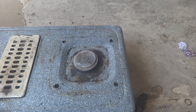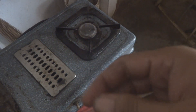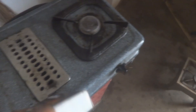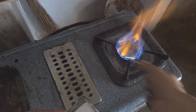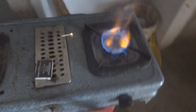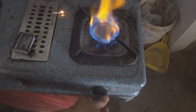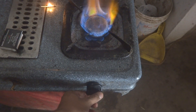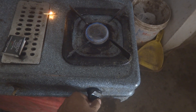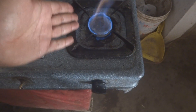Now I am going to test it — I will show you the testing. Open the gas valve. Now we will switch on this unit. As you can see, now it is burning, and it is burning very well. There is a control — you can see small flame, big flame, medium flame — any type of flame we can control. It is controlling gently. So this was a repair on this unit that we just made.